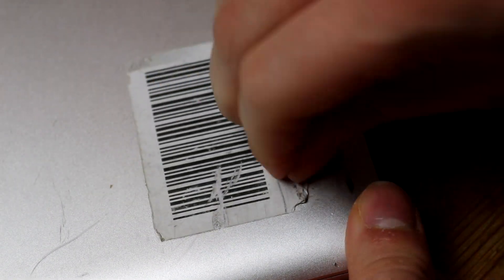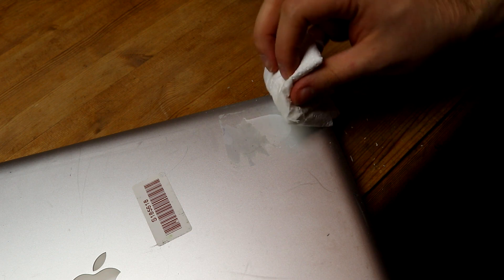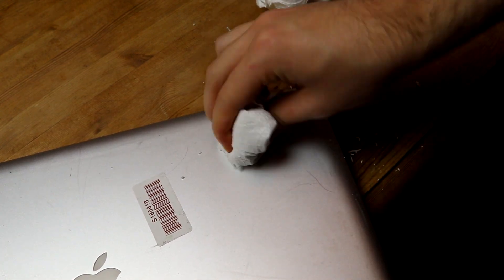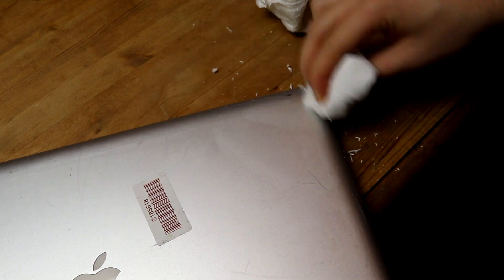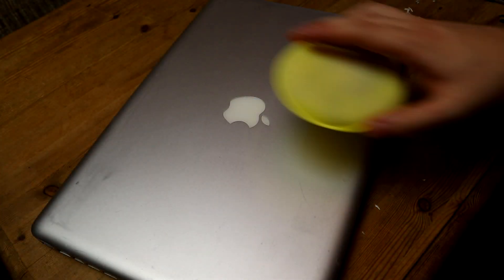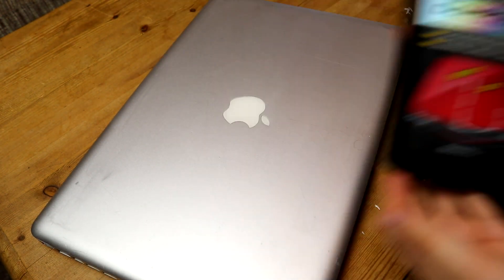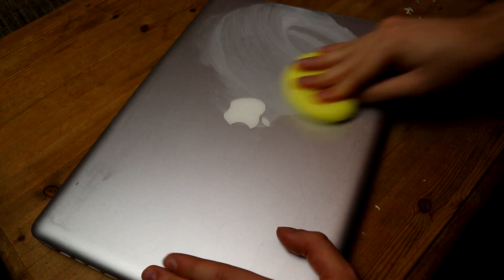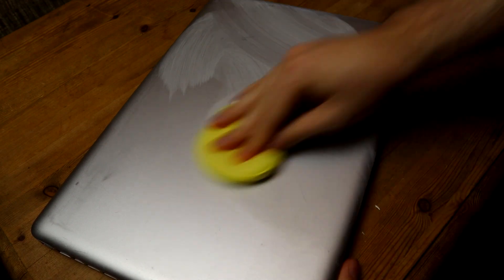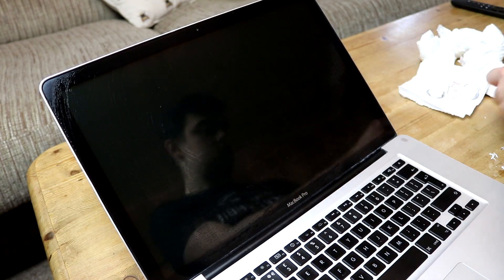Then I had the tedious task of removing the stickers. It would have been great if these were nice and easy to remove, but instead they refused to come off and left a sticky residue. So prying them up slowly with my fingernails and then soaking them in isopropyl alcohol to remove any remaining stick, these stickers were removed in just a couple of minutes, even if it did take a bit of blood, sweat and tears. Now we're almost at the point when visually this laptop won't be getting any better. I won't be able to remove these marks and scratches, but I can at least make the top feel like new. I took some of the Meguiar's Ultimate Compound and a microfiber pad and used that to buff out any minor scratches. It won't save the looks of this device, but it will certainly make it feel much smoother and much more like how it would have felt coming out of the factory. I then cleaned the display with another microfiber pad, using some generic window and glass cleaner to remove any fingerprints and smudges.